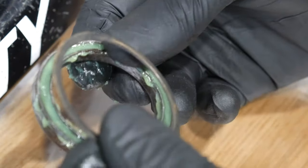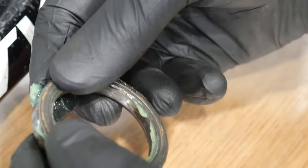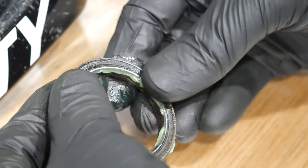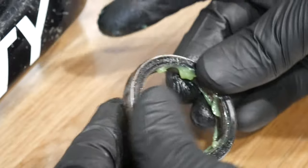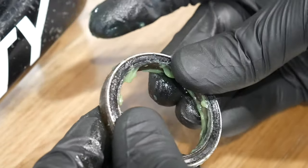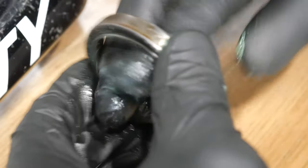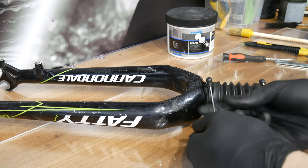Now I'm putting in more grease than you would normally, because those seals have been damaged by somebody who was putting the bearing on the fork with a hammer and a screwdriver. It's a really common mistake that damages those bearings. This one will be the upper one and will go down to the bottom. It works, no play, it's safe, it will be just fine. Now I can reassemble the fork and put it back on the bike.